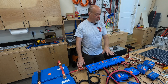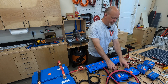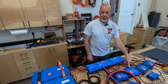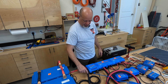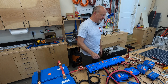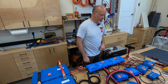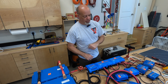I'm not going to power the system on and show you these in the Victron Connect app because they won't come on. This positive is the output of the Orion, so if I had a spare battery I could send its positive to one of these inputs. However, part of the idea is that this bus is also going to have a chassis ground — a four-aught chassis ground in the van — which connects back to where the negative is on the batteries under the seat, the CCP post, etc. That completes that circuit, but since we don't have that in a tabletop demo, I can't really fire these up.